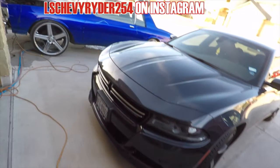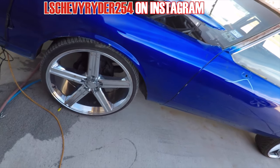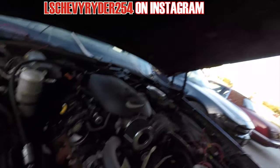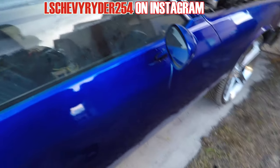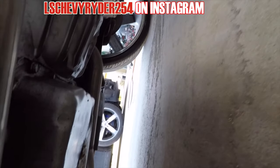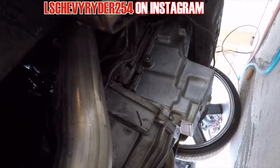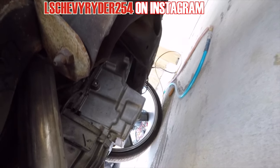So here we are outside. I want to say that the Caprice is in a good spot for this harness removal and reinstallation. As you can see, I keep the battery on the tender. I'm thinking probably the only thing that we'll have to actually do that may prove to be a little difficult — just drop that starter so we can put that line on there and get that crank position sensor plugged in behind there. Might want to jack the car up a little bit for that, give us enough room to work with.